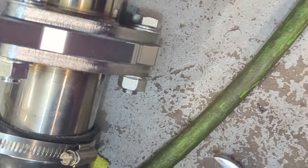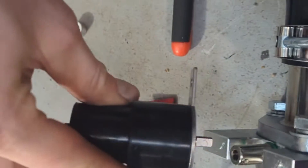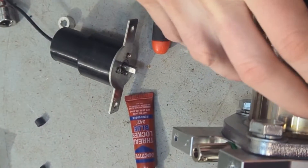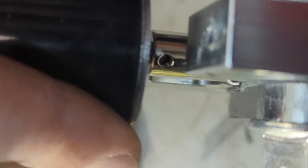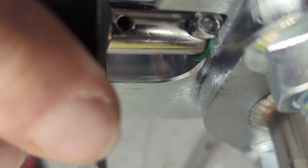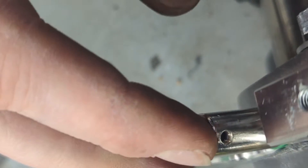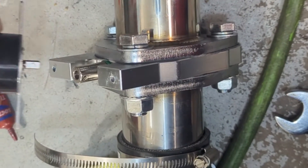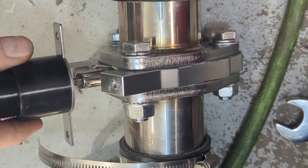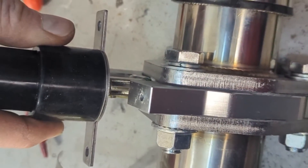I've shoved in a very small bit of rubber hose. I'm going to pressurize it — you'll hear a hissing sound, and then I can demonstrate that plugging it stops the hiss. Currently the bottom O-ring prevents the original air leak from escaping, and the middle hose bit prevents the inside of this union from letting air escape through. The squish should be necessary to prevent the hissing. I'll do one last test and then put it back in the car.